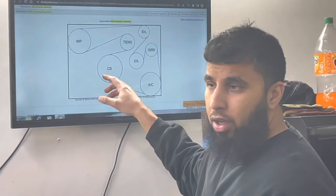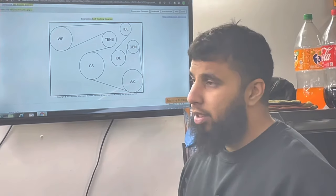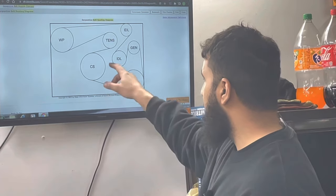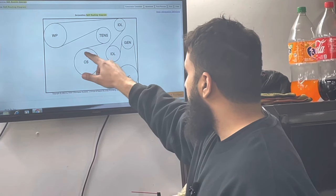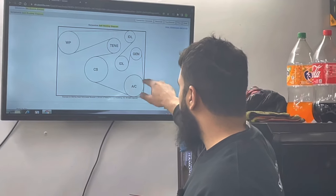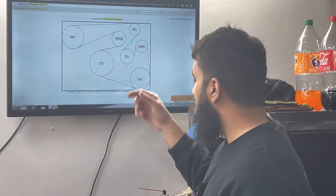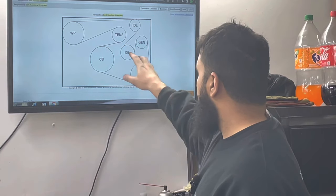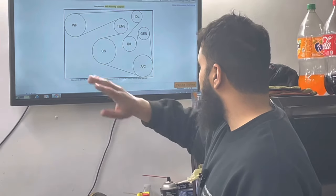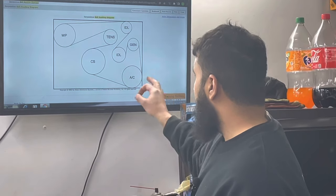What we're going to do is remove the belt and then start the engine. If the sound is no longer present, that's a good sign — it means the sound is not coming from something internal. The crank pulley spins all the time with the engine, but when the belt is removed, none of the accessories spin. That eliminates the internal engine and all those components.